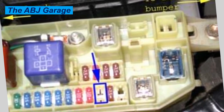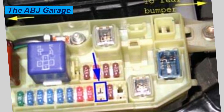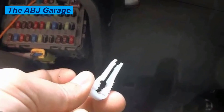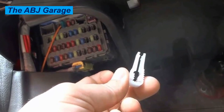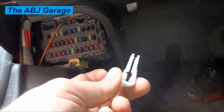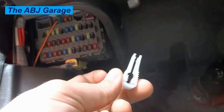To use the fuse pull method, first locate the fuse box. If you're not sure where it is, consult your owner's manual to find the interior fuse panel — it is usually under the dashboard, sometimes in the glove box, or under the hood. Once found, identify the correct fuse using the manual's diagram. Look for a fuse labeled ECU, ECM, PCM, or engine control — these are different designations for the fuse powering the ECU.